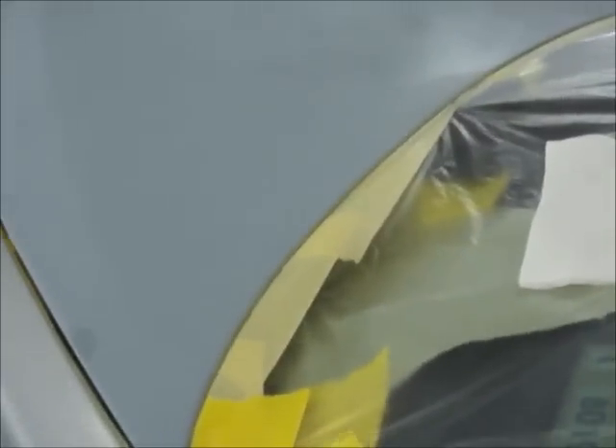Sealing is just a smart way to go for a light metallic anyway — you don't have to, but it'll save us from a strange-looking paint job. The hood is sealed now — I can still see a tiny bit of the imperfection but it'll be okay. I sealed over the primer, melted in the edge like you do a full coat. Then I hit some straight reducer in my clean gun and just dusted that edge to make sure there's a nice flat transition there, because I'm going to do my base coat now.